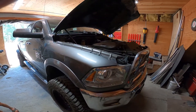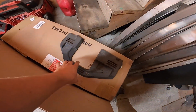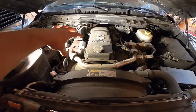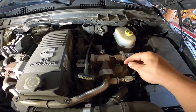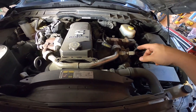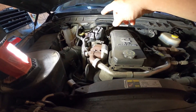It's kind of warm right now, so I'm going to wait for it to cool down. I took this cover off — the cover goes right here. Now you have to take this off, this V-band clamp of four bolts, the electrical connectors, same here. And then we'll take the cooler off and the servo motor.